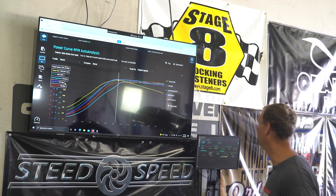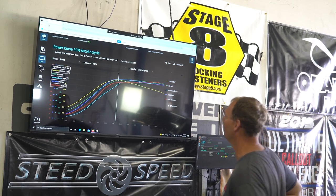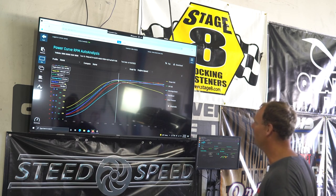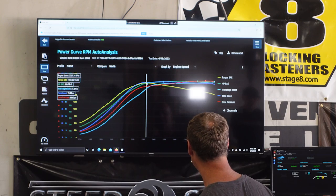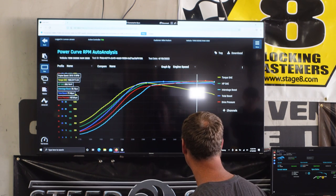That happened at what RPM? It actually happened at 23 something. That's 1930. Oh, I'm looking at the torque number. Yeah. So 1930 foot-pounds of torque. Peak torque happened at 2320 RPM. What was peak power RPM? That was 2800. So that's interesting.